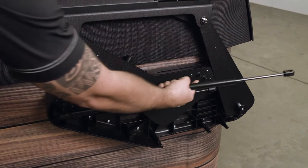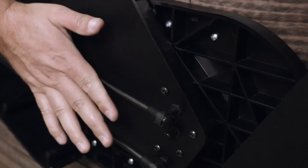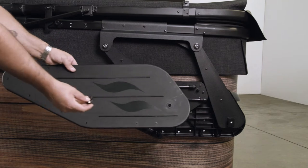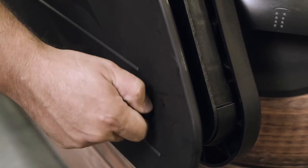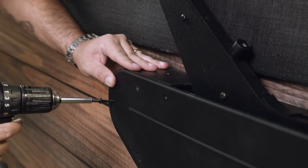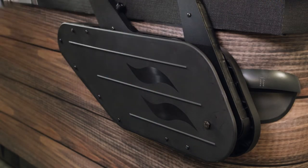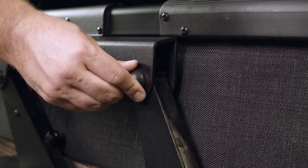Make sure the black body of the shock is pointing towards the middle of the Smart Top. Next, thread the 3/8 by 3/4 inch hex cap bolt through the hole in the cover plate that lines up with the rear pivot arm. Do not over-tighten the hex cap bolt. Attach the Vanish XL cover plate to the bracket assembly using the supplied self-tapping screws. Attach the plastic beauty caps over the hex cap bolts as shown.